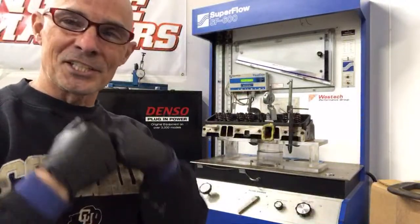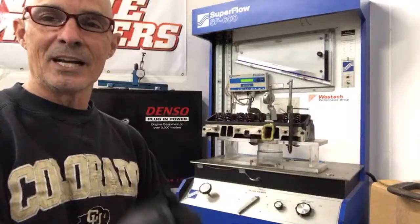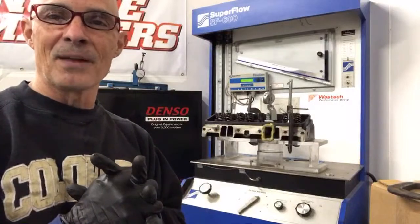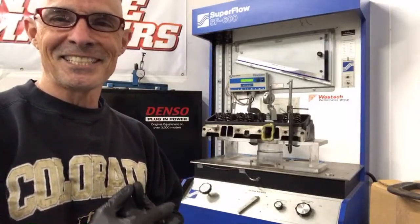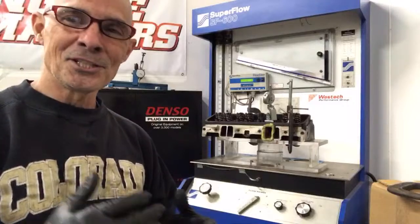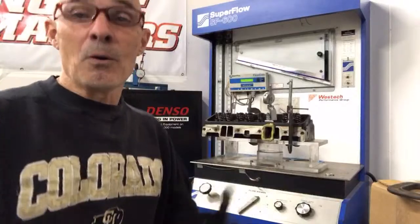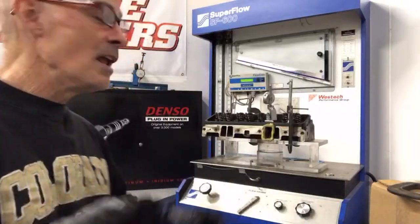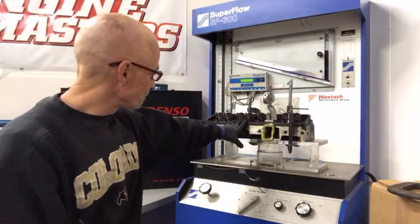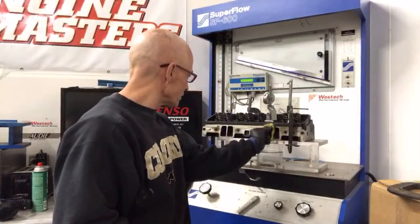When you go through all the work all day — tore all the accessories off, put all the adapters on, got this thing up on the dyno, pulled a Coyote out — and finally cranked it over, I thought there must be something wrong with the compression tester. Anyway, right now this is our L99 cylinder head — 1.84 intake valve, 1.5 exhaust valve. You can see I've got my fancy clay fixture here all dialed in. One thing to note: this head runs into a retainer-to-seal clearance problem at about 500 lift, so 500 lift is the maximum on this head.